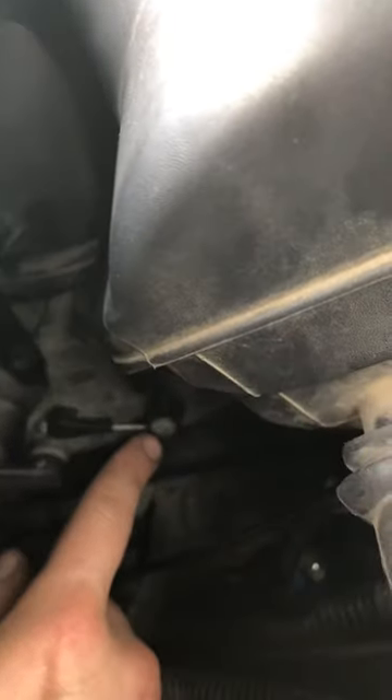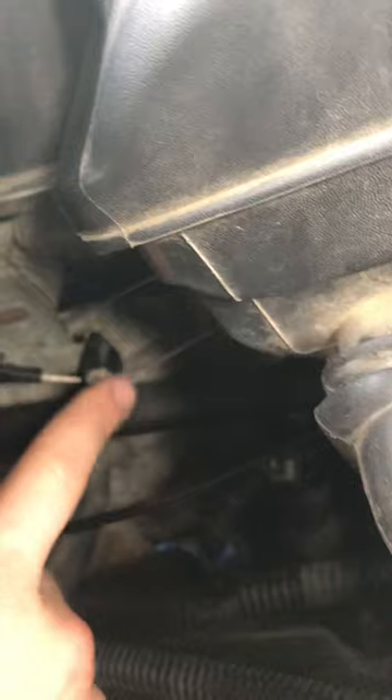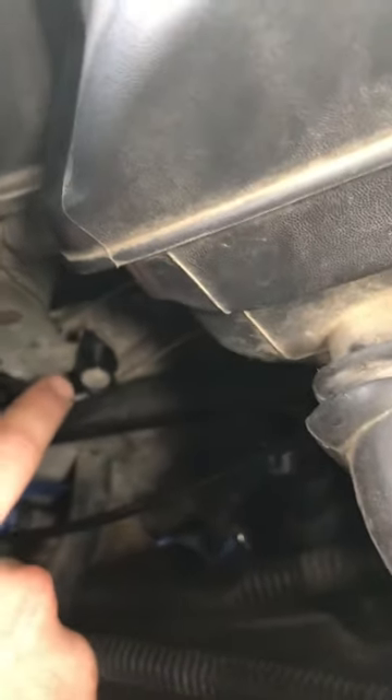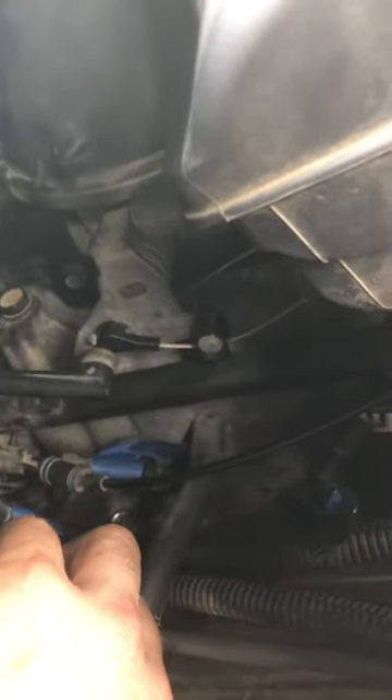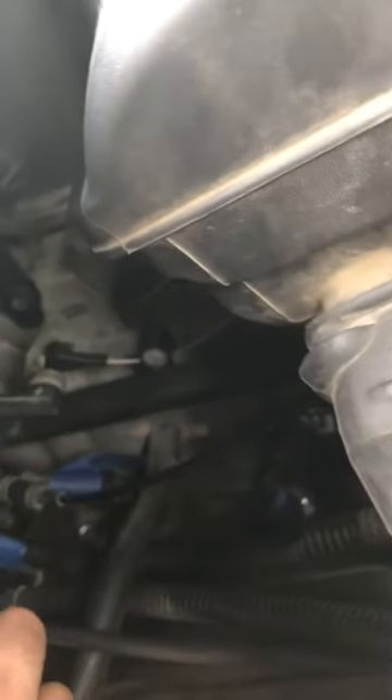Come around here — you don't take anything off. You just have to make sure that when you routed the throttle cable back, you see that black piece right out here? You've got to make sure you routed this cable underneath it. First time I did it, I had this cable out and it was just laying over the top or to the side of it. You're gonna have too much slack and barely any acceleration. But if you slip it back under this cable, you should be good.